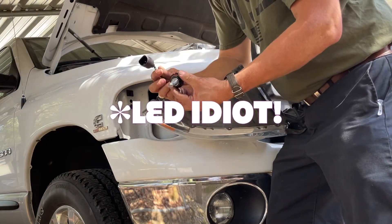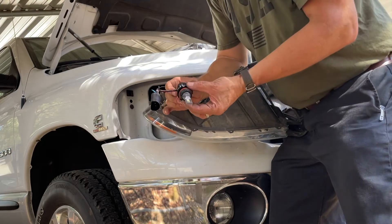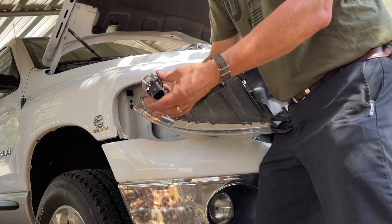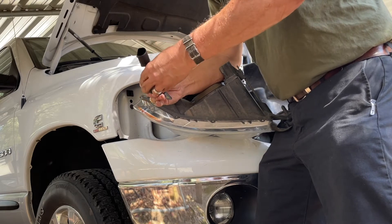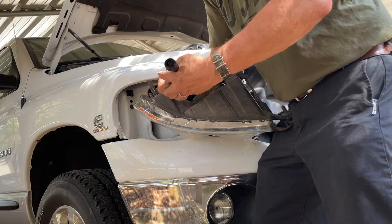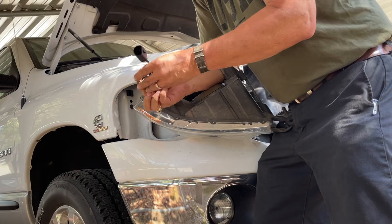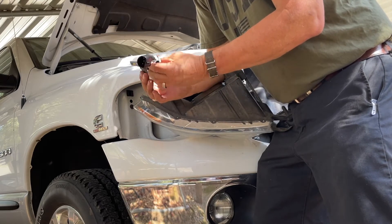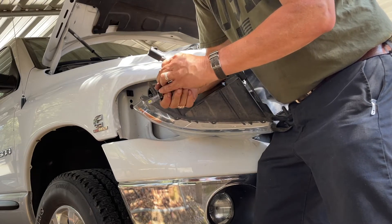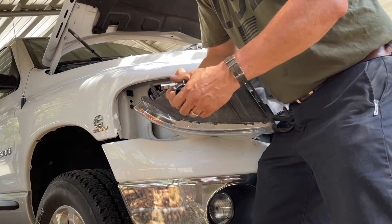So this is the halogen LED bulb that I put in — it's got a thing on the other side and a fan in the back. It's probably an upgrade because these trucks just have the worst headlights. I gotta snake this over the top of that and then put the top on to get it in there. You just don't want to touch the filament area — if this was a regular glass bulb, touching it will make a hot spot.